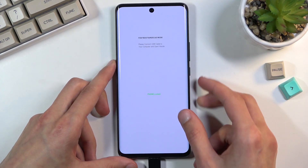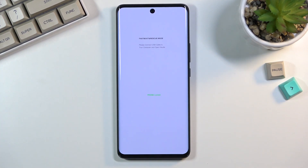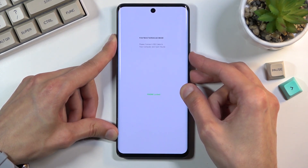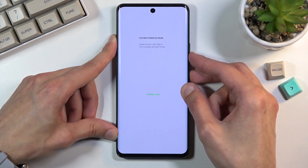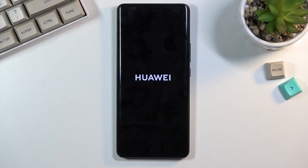That is how you boot your device into fast boot mode. To leave this mode, all you need to do is hold the power key and volume down at the same time until the screen turns off. This will take about 10 seconds or so before it reboots. Once the screen turns off, let go of the keys and simply wait for the device to boot back up.